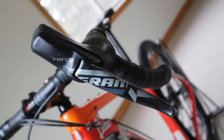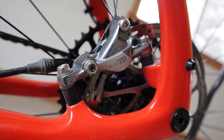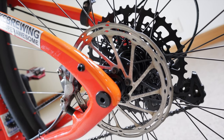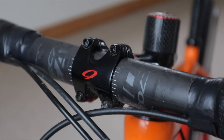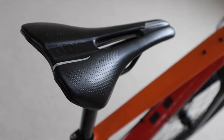For shifter, brakes, and derailleur — all of them are Force 1. Force HRD hydraulic disc brakes have much more stopping power than mechanical brakes, which is great on steep high-speed descents with a loaded bike, and also minimizes hand fatigue over long hours in the saddle. Force 1 rear derailleur, 11-speed. My handlebars are carbon — Easton EC70 AX, 44 centimeters wide. These are basically Easton's carbon gravel bars with a little wider width and a little more flare. I tried a bunch; they're comfy for me.